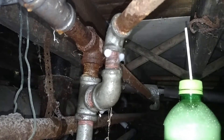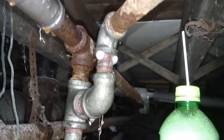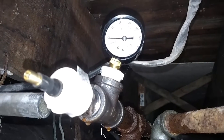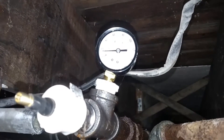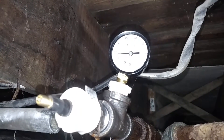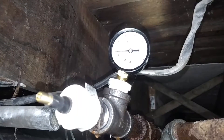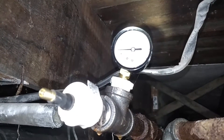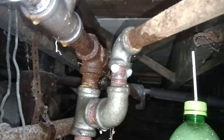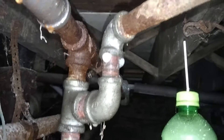Mainly I just want to show you this technique for finding gas leaks that you couldn't normally find, because those are real tiny. If it was a bigger leak you'd have bigger bubbles. That little contraption right there — you just take a pump and pump it up. I've got about 15 to 16 pounds of pressure and it's holding. It held overnight and only got down to two or three pounds, so the leak is so small it probably wouldn't even matter, but because I know it I'm going to go ahead and fix it.